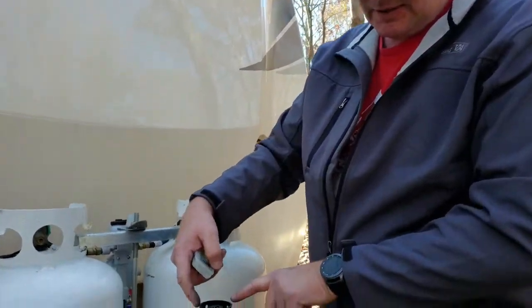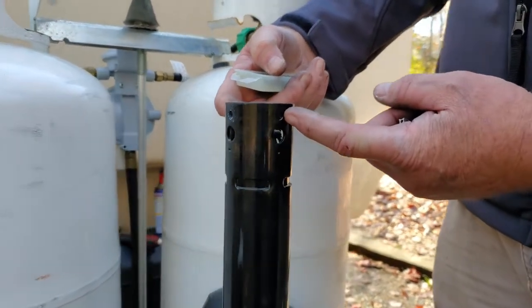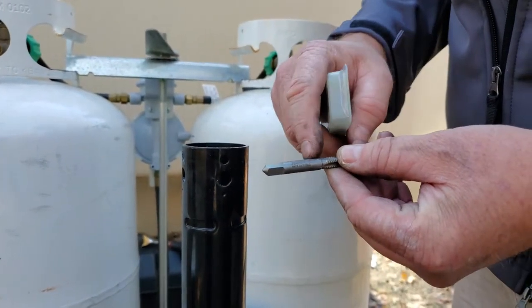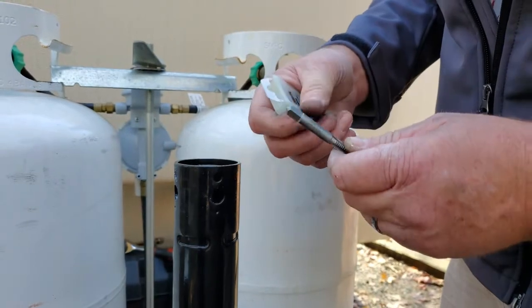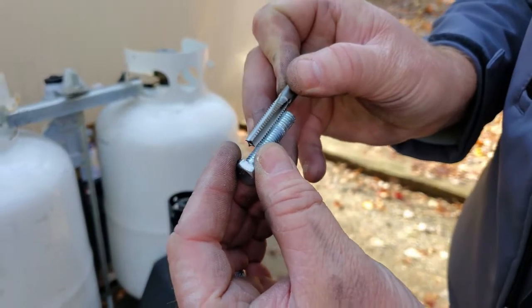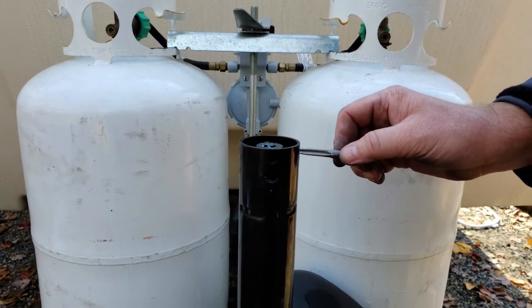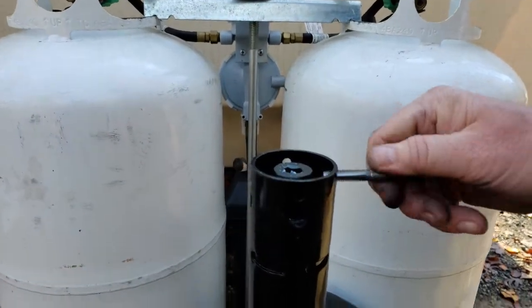We've opened up the head, and you can see these are the two threaded bolt holes that held the top on, but we also have two additional bolt holes here — they just aren't threaded. So what we need is a 5/16-inch, 18-pitch thread tapered tap. We'll put a link in the description for where to get these; you can get a three-pack with a taper, a plug, and a bottom, and we're going to use the tapered one. You want to double-check that the thread of your tap matches the thread of your bolts, and another way to check is to put your tap in the existing bolt hole and make sure it threads in smoothly — just like that.